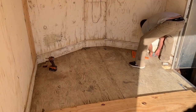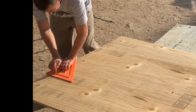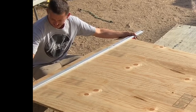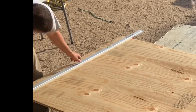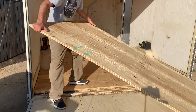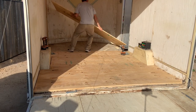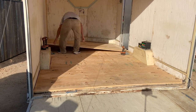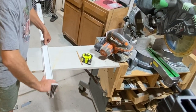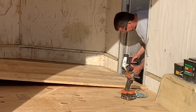I removed the front two floor tie-downs to cut the final piece of plywood. This time I remembered to cut it to width and check front-to-back for square before setting it in place. I purchased a straight-edge clamp from Harbor Freight for this project — very handy, especially for longer trailers with multiple pieces. Because I mostly use a table saw I didn't want to spend a lot, and this one did slip on me a bit, but it got me through. Spending a little more on a higher-quality clamp would have saved a few choice words.